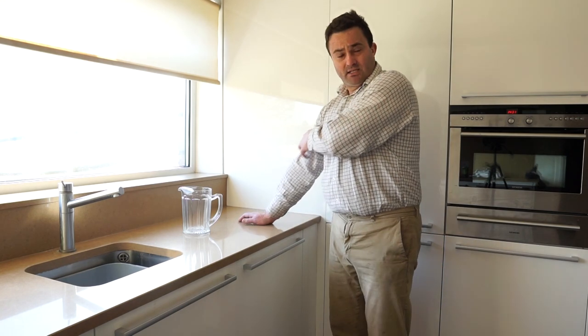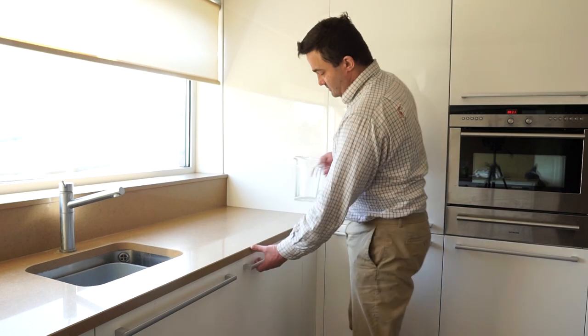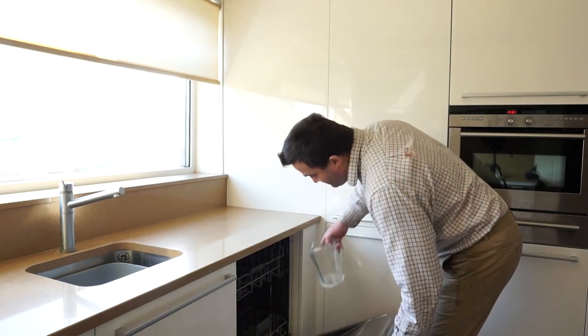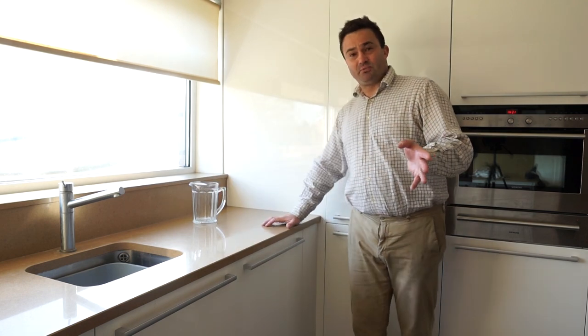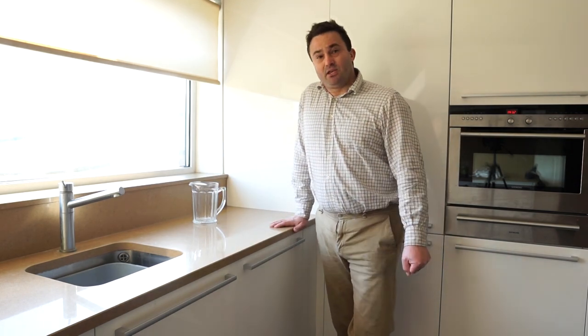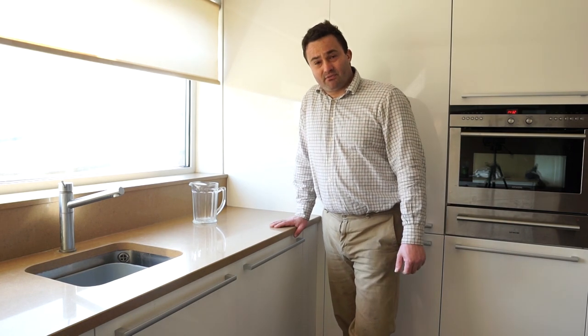You don't have to take the machine apart at all in order to test it. All you need to do is when the machine is about 20 to 30 minutes into its wash, take two large jugs of water and just pour them into the back of the machine. If that helps the wash cycle heat up, then you know that's the issue. The problem actually turned out to be with a transfer hose that sits in the bottom of the dishwasher.